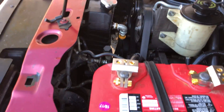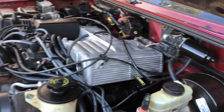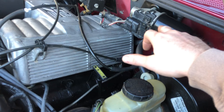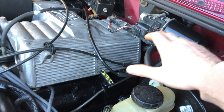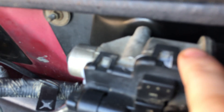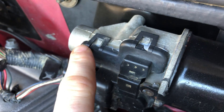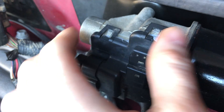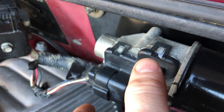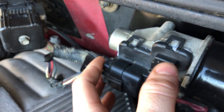The fuse panel and the whole engine wiring harness are out of the 5-liter, and everything goes pretty much in the same spot. The windshield washer motor is the same but the plug is different. You can pry these little tabs — it goes all the way around — and pull this whole plastic piece off, which is what I did. I pulled it off the 2.3 and put the one from the 5-liter on, so the plug goes right in.